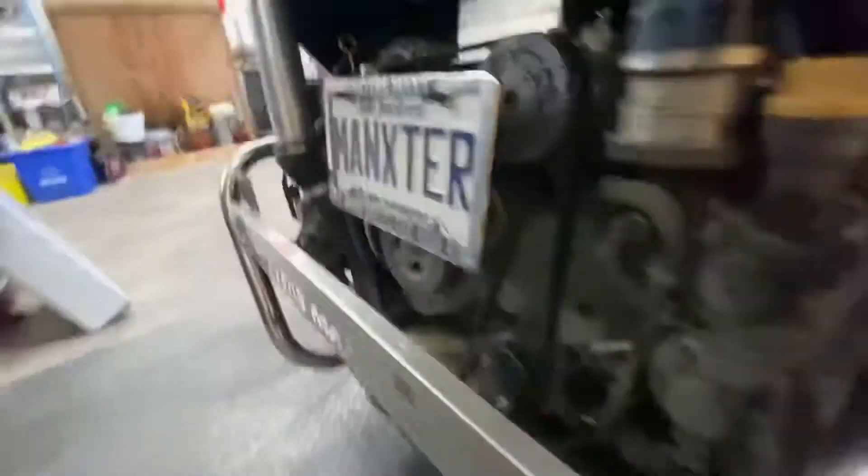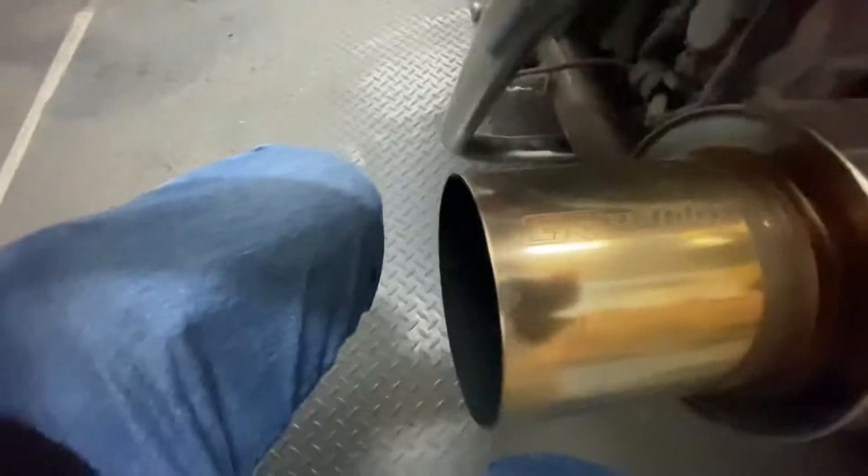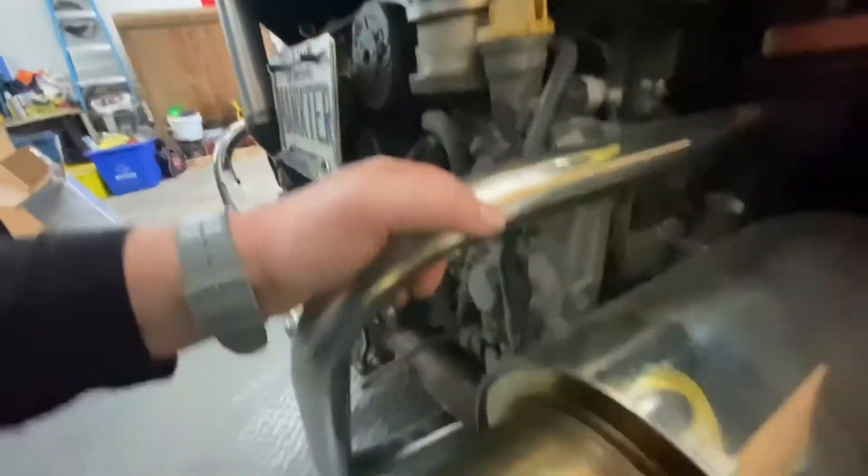As far as the exhaust, coming off the turbo I went pretty simple. I used an aftermarket downpipe from the turbo, which gave me the opportunity to mount the stock O2 sensors. I could have used the stock downpipe but it's a cast-iron piece, weighed a ton, and looked like garbage. Then I took a piece of 3-inch stainless tubing — the kind sold on eBay that has a 180 and a 45 — you cut and weld as needed. I just took the 180 portion and welded it to a Greddy exhaust, and it's worked well.